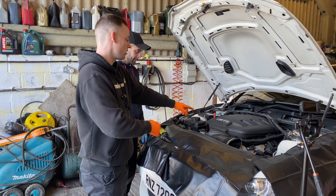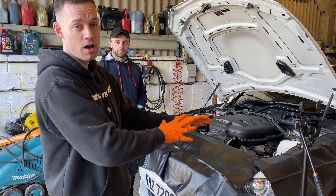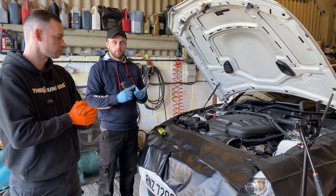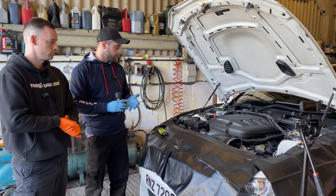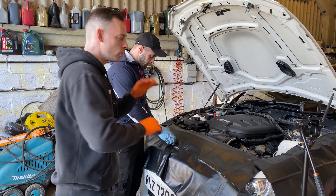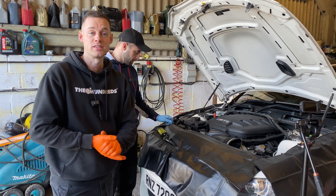The plenum is back on, actuators are all fitted up, and we've connected the connectors. Now we're doing a full service. Tor explains the standard scope: oil and filter, micro filters, air filter - there's only one on this model - spark plugs, a vehicle check service, and a brake fluid change. The car was serviced last year, but with everything already out we thought we'd do the plugs and air filter. We took it out and it was really dirty.